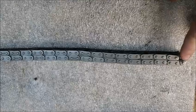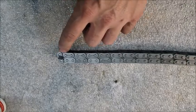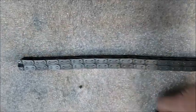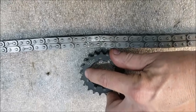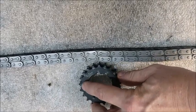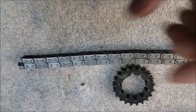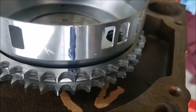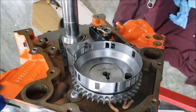Here's another little trick: lay the chain flat and pull it out so you know it's exactly halfway. Mark these two spots. Line the chain up and make a mark right there, because once this thing's in I'll know where it is. If after degreeing I need to go advanced or retarded two degrees, I'll erase that mark and make a new one. I do the same thing on the crank sprocket — mark it so when I put the timing chain on I know I'm exactly right.